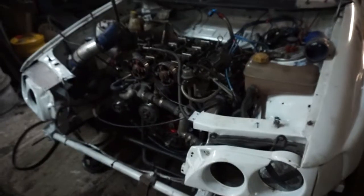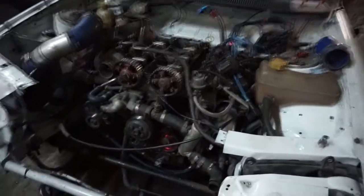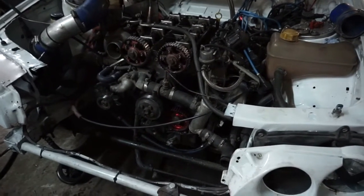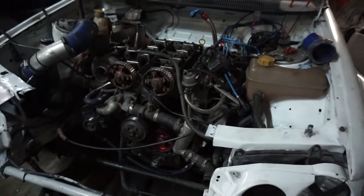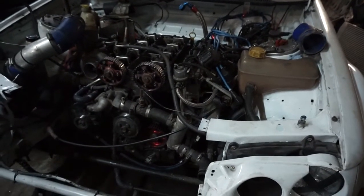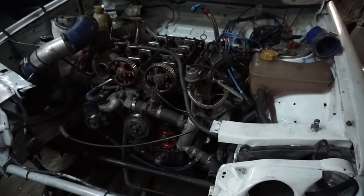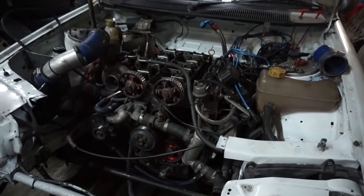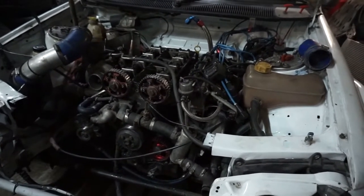This is a couple of days later. I'm probably just going to make all this into one video, just trying to find this myself because it's really getting to me. I've videoed a couple of bits. As you can see we've got the intercooler, radiator out, rocker cover off, and loads of bits stripped off basically. I'd done the throttle body and phase sensor the other week and it didn't make a difference. I also got another ECU and tried that and that didn't make a difference. I started just changing loads of bits, changed every sensor on it and still no difference.